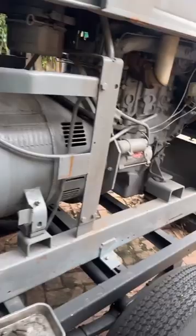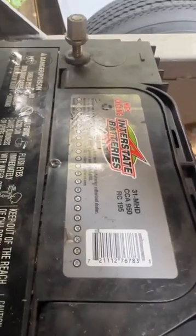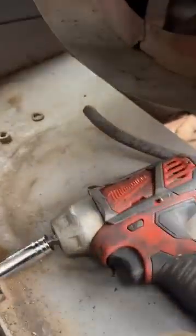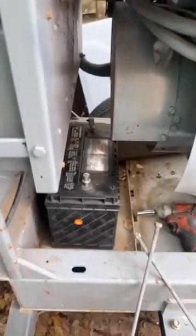I'm going to do the batteries and then show you around once we turn it on. This is the SAM 400 — this battery is too big, it doesn't fit with the bracket sideways. It's a 950 cold crank, 31MD with 117 amp hours — so it's good, it works well. I'm going to change the ends. The best way is to cut it, get it like a tab, and rewire it. Put a hole there, repurpose the existing holes, and put rubber for friction so it doesn't damage the battery.